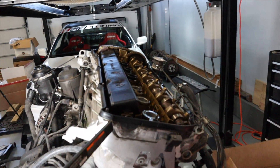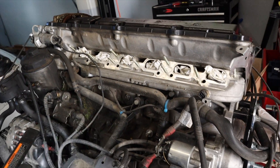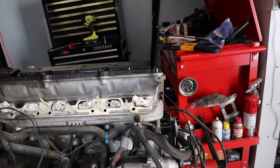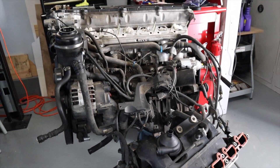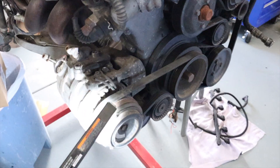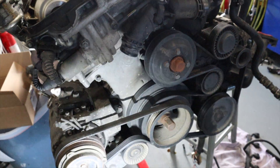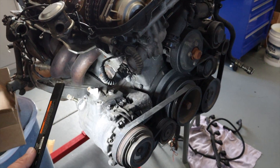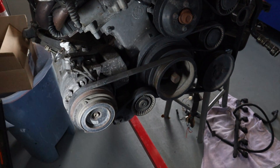I'm going to replace this gasket, these two coolant hoses that sit underneath the intake manifold, and get all the maintenance done underneath this engine block. I cleaned around all the ports to make sure the gasket is going to seal properly. It's so much easier to work on this engine on an engine stand. The other thing I might do today is get the AC compressor taken off — that is going bye-bye. We're not reusing the AC compressor, tensioner, belt, or bracket. We'll probably lose about 15 pounds off the front of the car and get rid of a little parasitic loss.